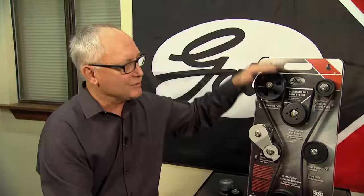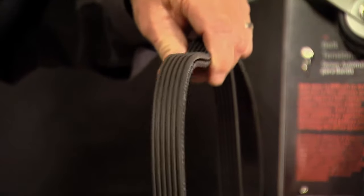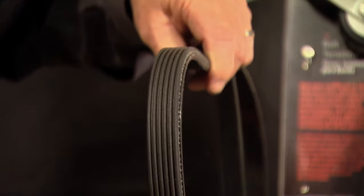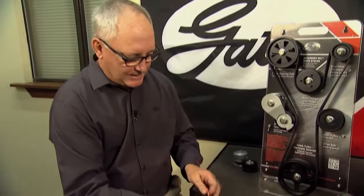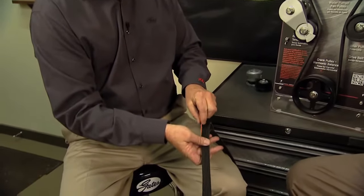The danger is that when the technician replaces an alternator, a power steering, or some other accessory, when they look at the belt, they say, oh, that looks okay, but in fact, it's totally failed. And that's why Gates produced this little belt wear tool to help use the visual you need today to tell if the belt's worn out.